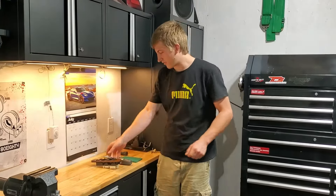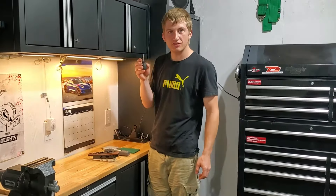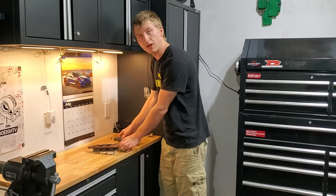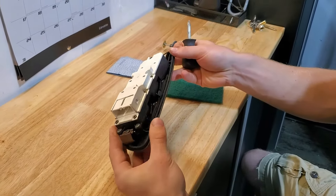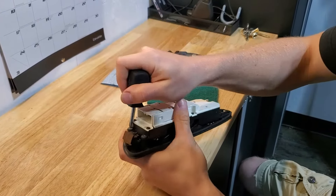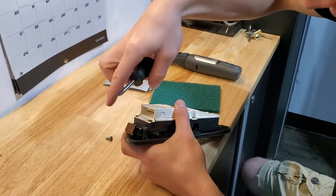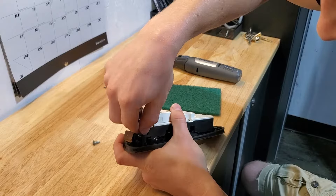Here we are in the shop. I've got my defective window switch and a few tools: a Phillips head screwdriver to take it apart, some Scotch-Brite, some sandpaper, and a little wire wheel. If you flip over your master window switch, you'll see there are a bunch of screws. Usually they're Phillips. You want to be very careful because these are just going into molded plastic, so be careful taking them off and definitely don't reassemble with much torque at all.